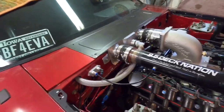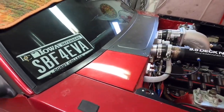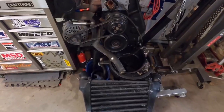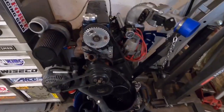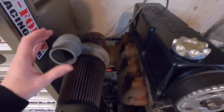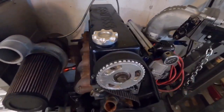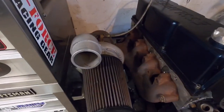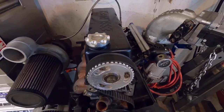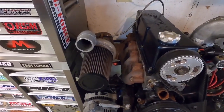On my red Mustang I use what's called an air-to-water intercooler, and we'll get to that in a moment. But first, over here at my little 2.3 turbo, let's talk about intercooling basics and air-to-air intercoolers. On a turbocharged car, you don't have to run an intercooler at all — you could literally just pipe it straight to the throttle body, pumping air straight into the engine from the turbo with no cooling whatsoever. That's technically fine, but the problem is turbos make a lot of heat, and pumping hot air into your engine creates detonation and is bad for efficiency.